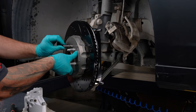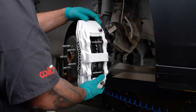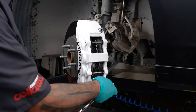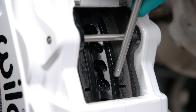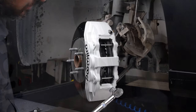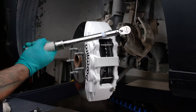Reinstall the rotor with the alignment screw. Reinstall the caliper onto the caliper mounting bracket and temporarily tighten with the lock nuts. Check that the top of the brake pad is flush with the outside diameter of the rotor. If not, adjust by adding or subtracting shims between the caliper and the bracket. After the caliper pad height is set, torque the caliper lock nuts to instruction specifications.